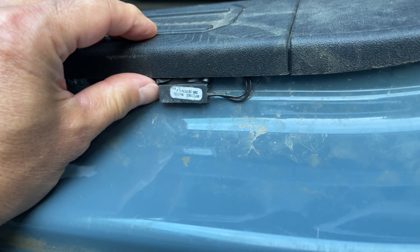One other thing to mention — not necessarily a positive or negative, just something to keep in mind. Rock Slide Engineering sells an optional skid plate, which is essentially an extra 3/16th-inch steel cap that fits right over the slider for extra protection, with an opening for the step to come out. You'd have to be hitting the trails really hard and all the time to warrant that extra protection, but it's out there if you want it.